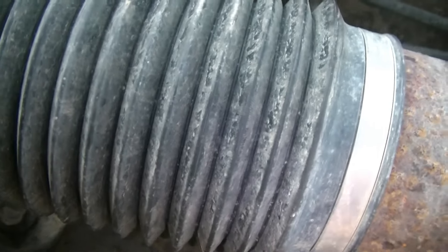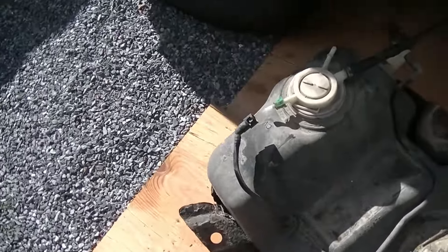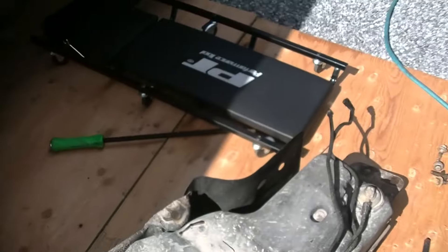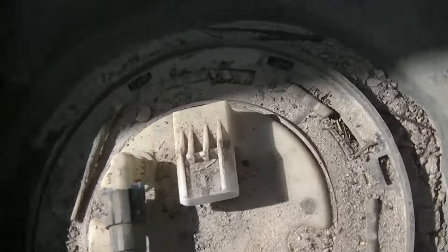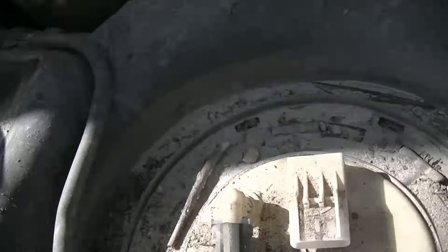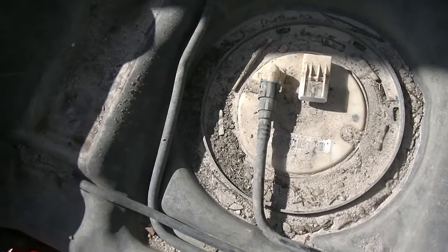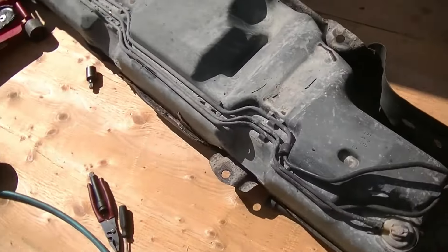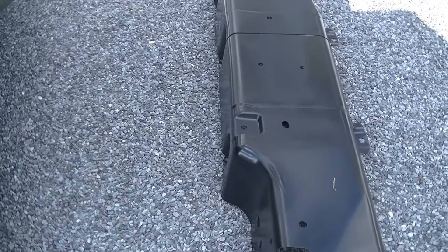Once I have the tank down on the ground, we'll pull it out from under the truck and show you what we're going to do about the fuel pump. We got our fuel tank out here — I didn't even have to disconnect this, it can go right back on. Now we're going to disconnect this because we're replacing the fuel pump. First I'm going to grab my vacuum cleaner or blow gun to get all this dirt out so that when I pull this fuel pump out, none of this crap falls into the tank. Then we can lift the tank up and out of this fuel tank support, slide it over, and drop it right onto the new one.